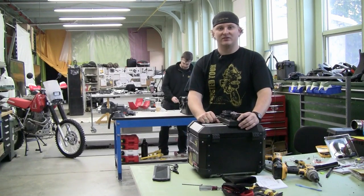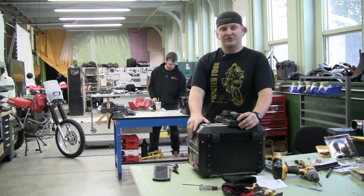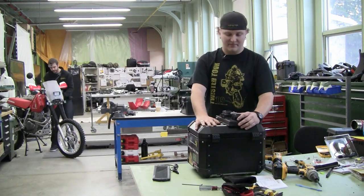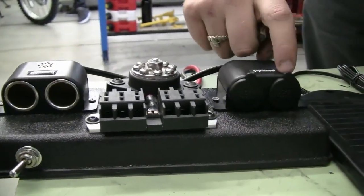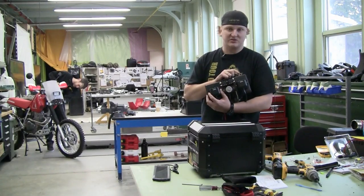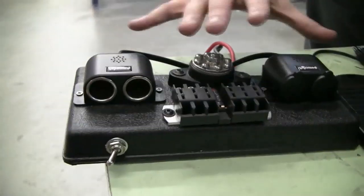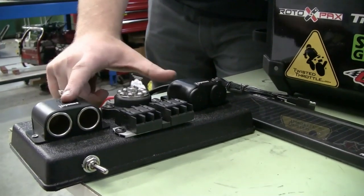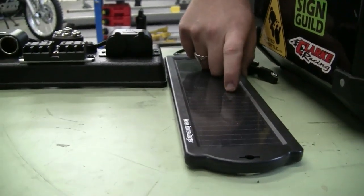In order for Pat to document his travels he's got to bring along stuff like video cameras, still cameras, and a laptop. When he's not actually at a place with land power he needs to be able to charge this stuff, so we're building the whole power station in the top box here. We need to have cigarette sockets so we can charge the items, and each socket needs to be individually fused to protect the item. We also want a switch — flip it one way and power comes through a secondary battery in here powering his items, then when they're charged up he can flip the switch the other way, which turns the sockets off and flows power from a solar charger into the battery to recharge it.